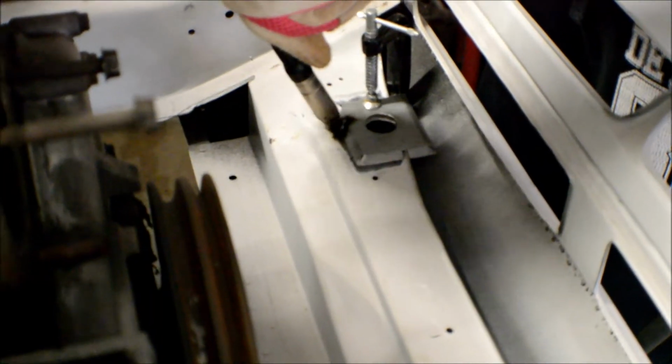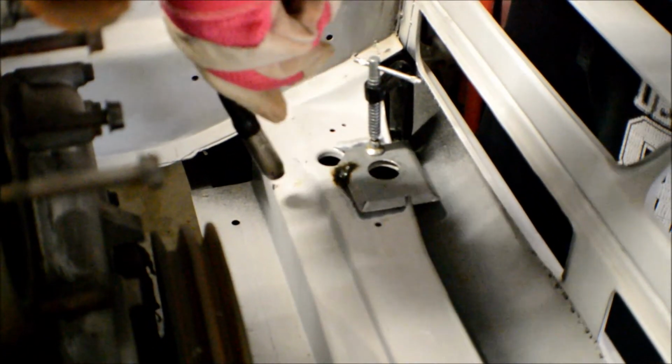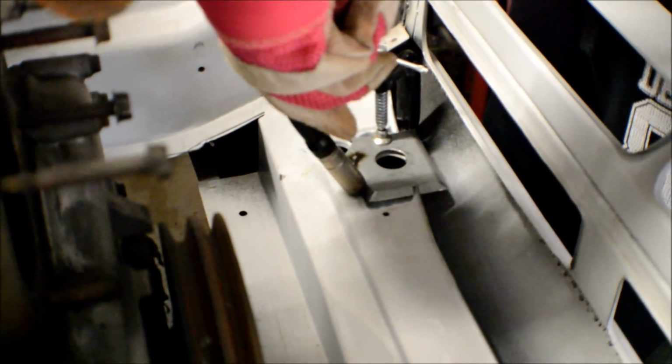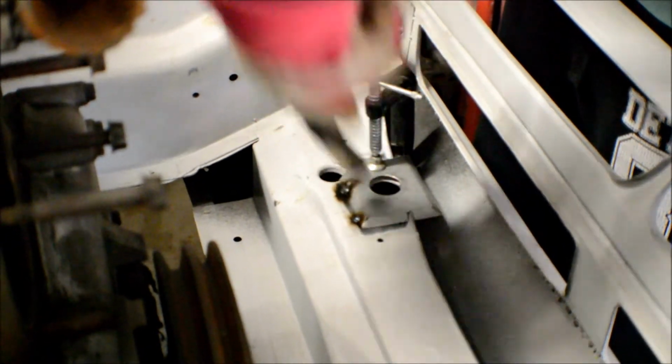Yeah, I don't think that one grabbed. I think you were too far up. So, yeah, there. Yeah, you have to go a bit longer than that though. Alright, do the next one, and then we'll review that one. That's better. Okay, that's a tack length, okay? Try that one there. Yeah, get yourself comfy.